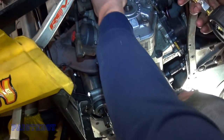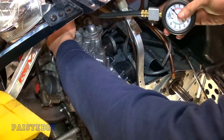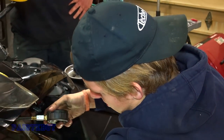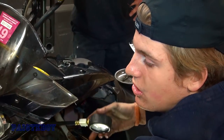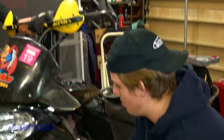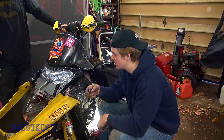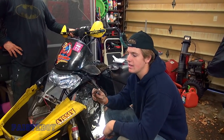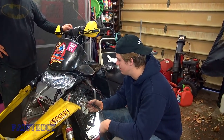The other one was slightly lower. There's a percentage that they can be different — every motor is set for different tolerances. It doesn't make a difference. It's also dry — nothing's going through them. This isn't an accurate reading because you're supposed to heat the engine up before you do a compression test. These motors don't run high compression because you're at constant steady RPMs. The race sleds are all high compression — they're variable. Probably clean those clutches up. Alright, we're going to check for spark here.